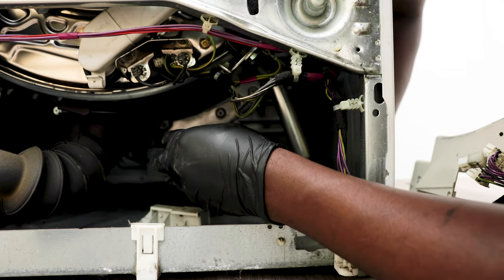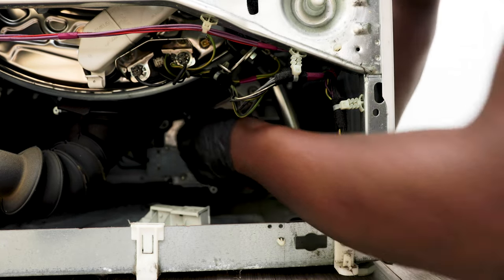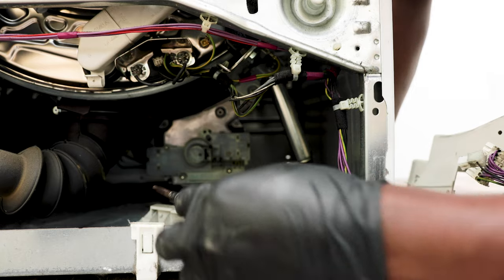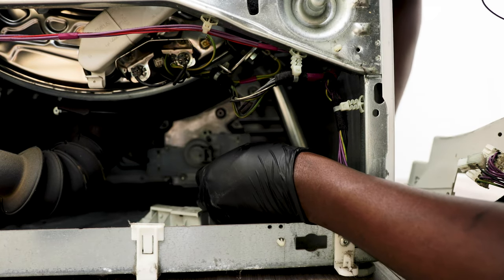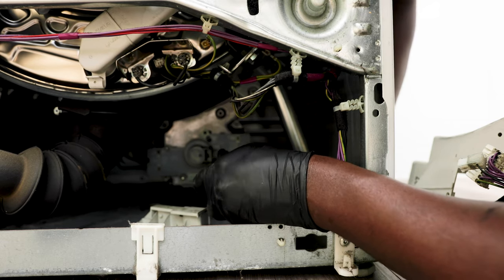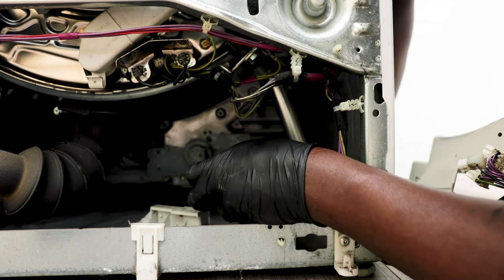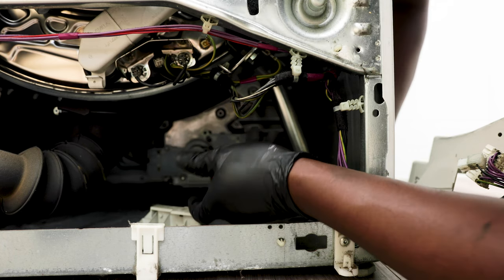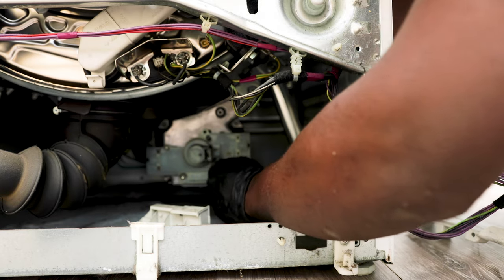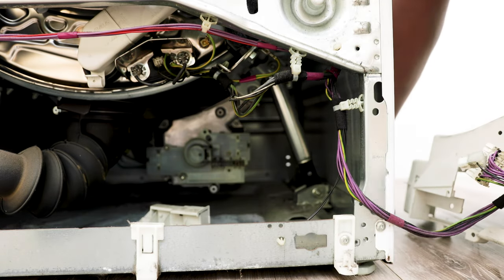To find the carbon brushes that go on this washer, you'd need to note your model number. Your model number is usually on your soap drawer — search that on eBay and it'll show you the Miele carbon brushes you need. I'll try to put a link in the description below. Depending on your region, your eBay or Amazon store will have people selling these, and nowadays they do the job.